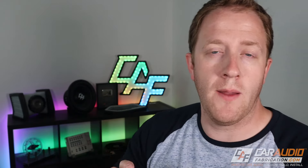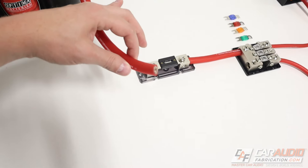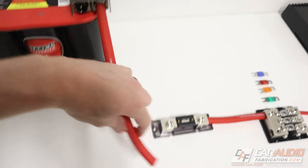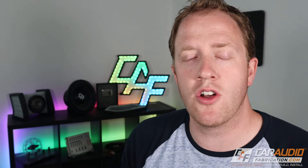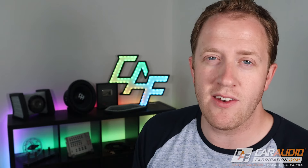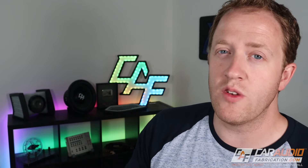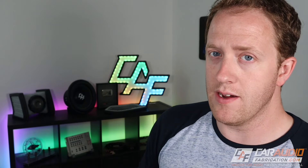If we don't have a fuse and the power wire connected to the positive lead of our battery touches ground — which is the body of the vehicle — we create what is called a short circuit. A huge rush of electrical current occurs, so much so that the wire can't handle that amount of current, and the wire will start to get hot — hot to the point that it can easily start on fire. So lesson number one is that the fuse also protects the wiring.